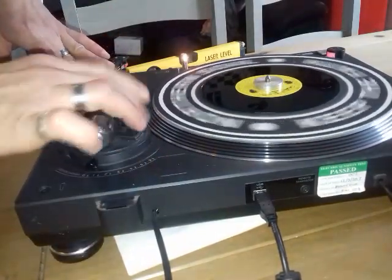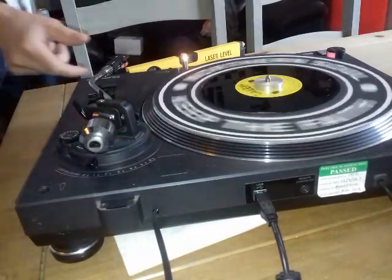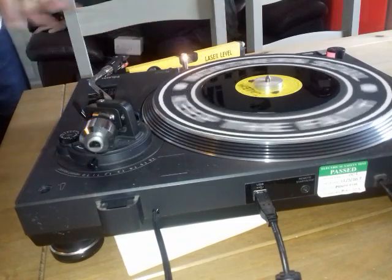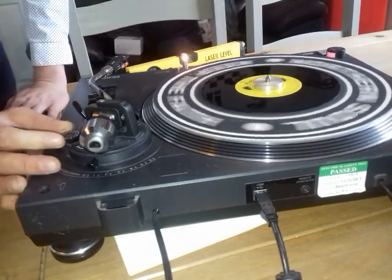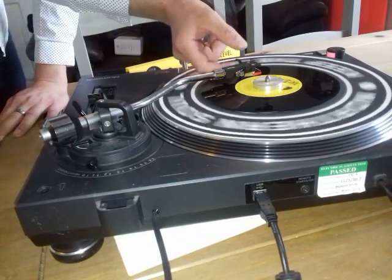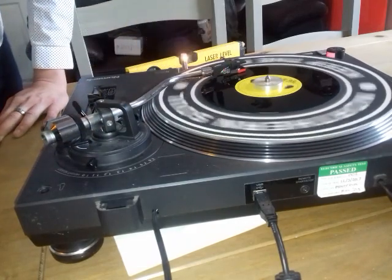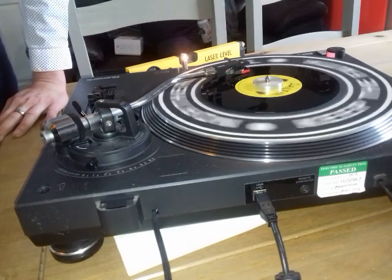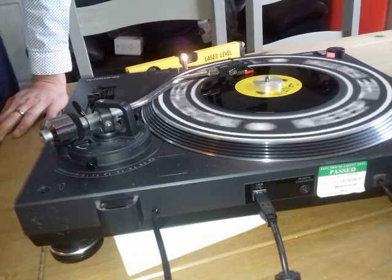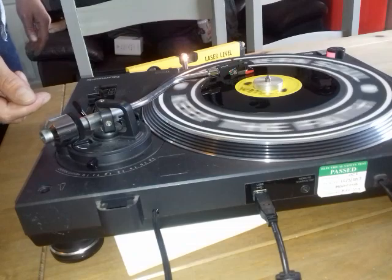So we need to wind this off — not all the way off — but find it somewhere near where it feels like it weighs nice in your hand, still rolling off to the middle. Now we use your anti-skate, and you need to crank your anti-skate up until you find the right medium. You see it slowing down as it crosses the vinyl — a bit more — put it down again, and that's just nicely tracking towards the middle of the vinyl. So we just give it a touch and it'll stick there, look. Now each deck's individual to its own environment, but in this instance, this deck is balanced.